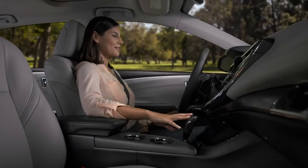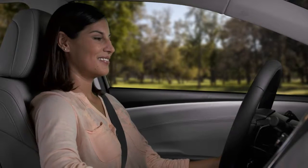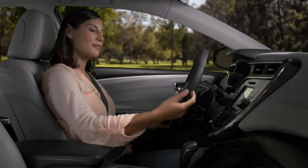To turn off all power, leave your foot off the brake and press the button one more time. If the battery in the smart key has a low power level and your vehicle won't start, try pressing the engine start button with the key.